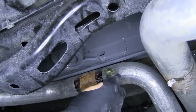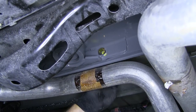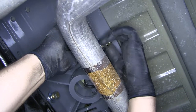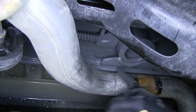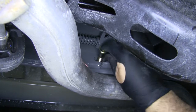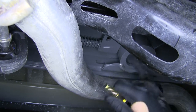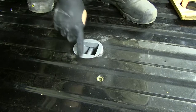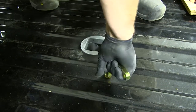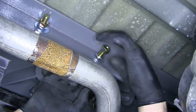Take your two-and-a-quarter-inch bolt — you want the head facing toward the rear of the truck. Slide it through, then put on your flat washer, your lock washer, and then your nut. We're just going to hand-tighten for now. The instructions say to only install the two center bolts from our center section into our front cross-member. There's a plate here that goes to our hitch pin, so we need to loosen it and slide the pin out to move this plate and get our bolt in place. Now you can see our hitch is staying in place once we've removed our strap and boards.